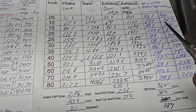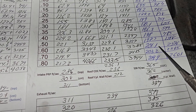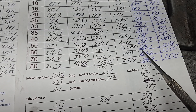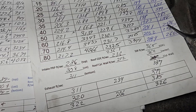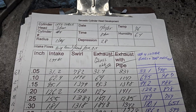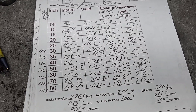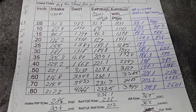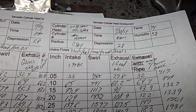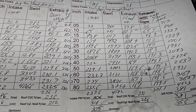We tested it on intake manifold number four base with the top matched — it actually did quite well. At that point we're getting 200–201. We got a good swirl curve, not bad. Then we tested it with the 70 millimeter stock. They all kind of say the same thing: pinch roof, straight wall, final — and you know I like to write 'final' with a question mark, because you guys know me.